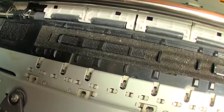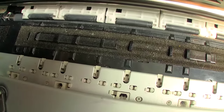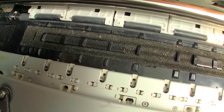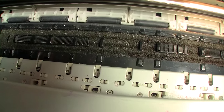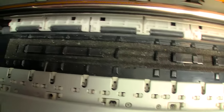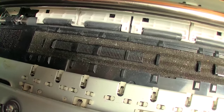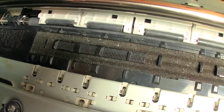So the printer driver over-enlarges the image, and so the printer has to print outside the paper, maybe as much as 5% beyond the paper. Well, that is caught by the sponge. So basically the ink that it is spraying lands on the sponge. And if you do nothing but borderless printing, you're going to make the sponge filthy. So what you do is you dribble Windex or other cleaning fluid and then dab it. And basically I just use paper towels.